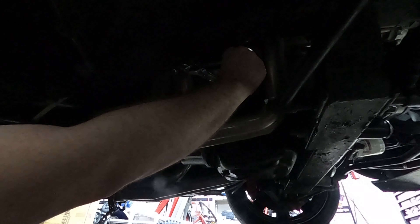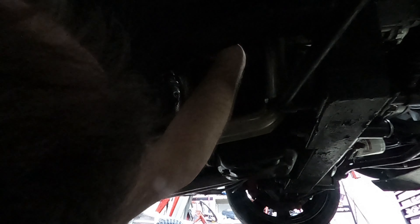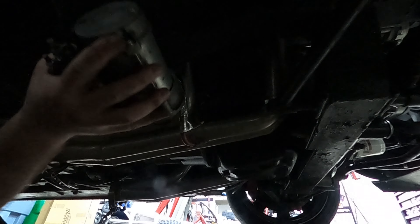An extension will help to get some of the starter bolts. Next is the steering rack - I know it's a 15/16th bolt on one side, and I don't feel like figuring out the nut on the back, so I use an adjustable wrench. This here is what takes apart the steering shaft from the steering column to the rack. For the headers, it's a 15-millimeter for the head studs, and then 3/8 - I've got two different sized wrenches, one swiveling and one fixed.